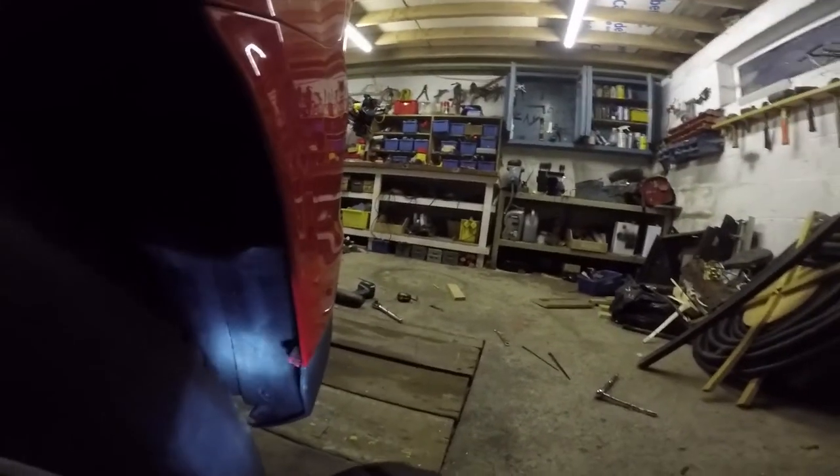I'm showing you all the points we'll take the bumper off. There's one bolt that holds the inner wing on — it's something like a felt material — and there's another one. You can see it, then you just pull this out of the way and move it to one side. There's a torx bolt that holds the bumper, so you're just taking the inner wing off and moving it back to get to the torx bolt. Same on the other side.